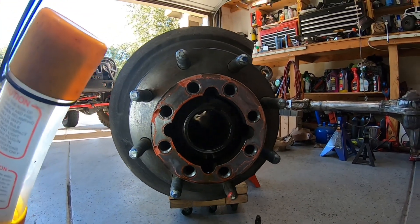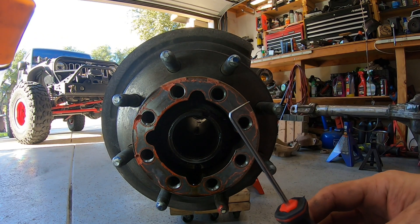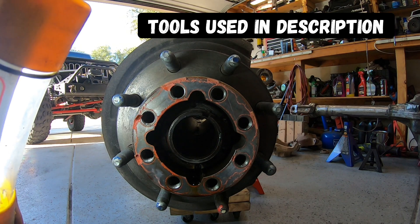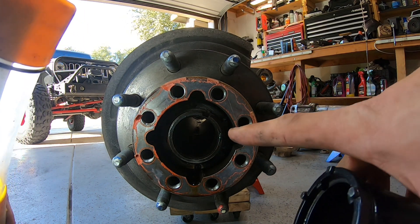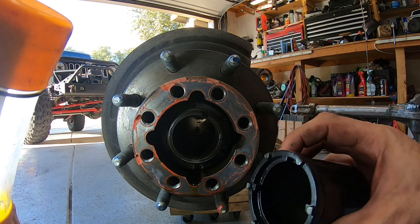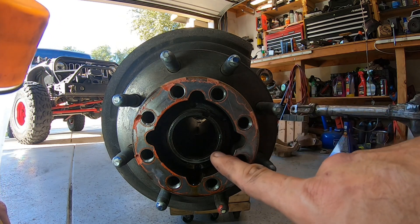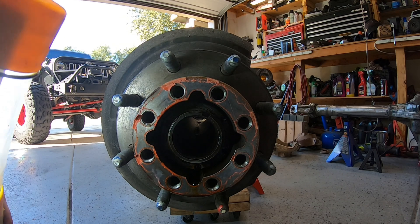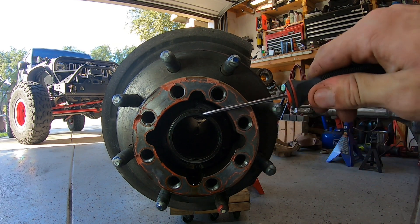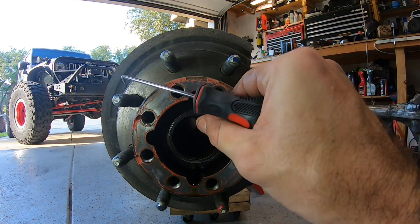For this next section, you're going to need a couple of special tools: something like a pick, a magnet, and then either a straight blade screwdriver to get that specialized nut off the end of the axle tube, or a socket literally made for a 14-bolt axle. You can tell by the teeth on the end of it that it's made specifically for this nut. The first step is going to be to remove the spring clip that's in here — you just lift up on it with the pick and kind of pull it out.